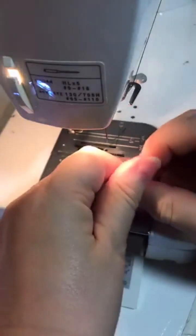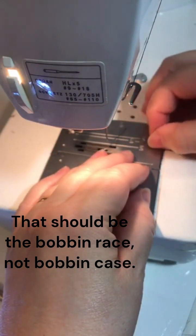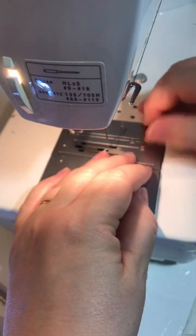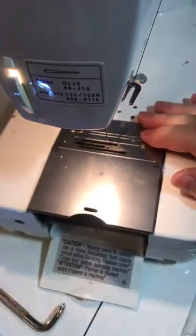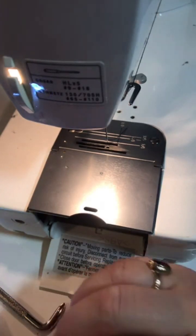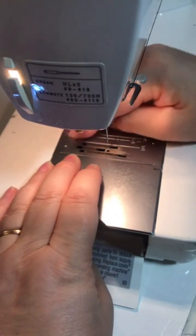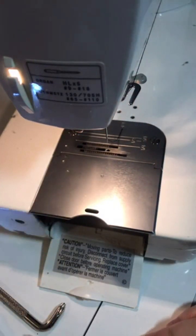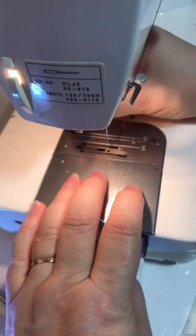Now this one you do not remove the bobbin case. This one you're going to leave that bobbin case alone. Now, like I said, I will oil this every once in a while according to the book. Okay, there we go. But that doesn't mean that I don't get it serviced. You still have to get it serviced whether you oil it or not, because there's parts in here I can't get to. We recommend that they be brought in for service by Justin at least once a year. But don't ever let any machine go more than 2 years without having them serviced properly.